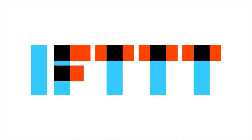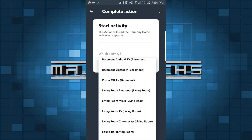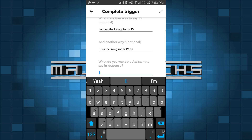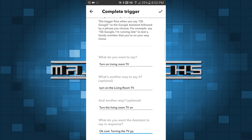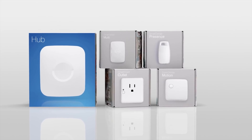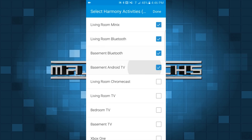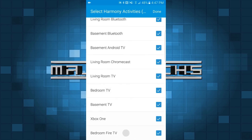There are pros and cons to using IFTTT as well. One good thing is you can control more than one hub with it. Another cool thing is you can use a custom phrase — you can say whatever you want to trigger the Harmony Hub, and have the Google Assistant say whatever you want in response. When it comes to SmartThings, it also allows you to connect to more than one hub, it's easy to set up since Harmony activities show as switches, and sensors can trigger activities like turning on a light or opening a door. One downside to IFTTT or SmartThings is you can't easily control things like volume, mute, previous channel, or favorite channels.